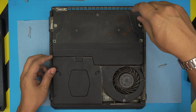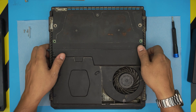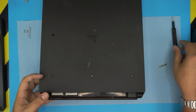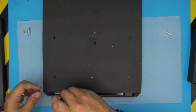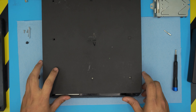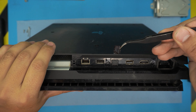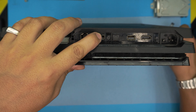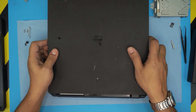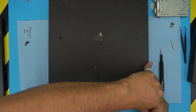Let's remove these two screws on top and the broken part of the shield. Before doing the bottom screws, let's flip it over and remove the bottom cover, because there are two screws holding it. Take advantage of the missing bottom cover to slide out the hard drive using a Phillips number one or zero. At the back there should be a screw under a warranty sticker — grab a tweezer to remove the sticker, then remove the Torx T9 security screw.